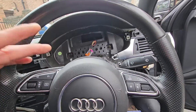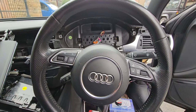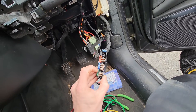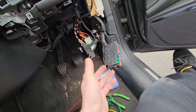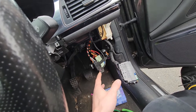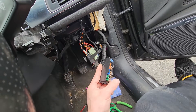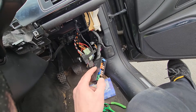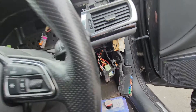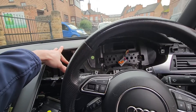I traced the fault and checked the fuses — fuses are okay. The fuses for the heads-up display and the instrument cluster are these two here, and there's power on both sides of both fuses. I checked wiring diagrams as much as I could using AllData — that's covered in a separate video and was a bit of an ordeal. They cannot tell me where the feed comes from for these two fuses, and they can't tell me where the connection is behind the dash for the positive feed for this connector and this connector.